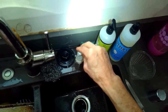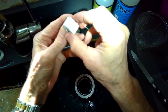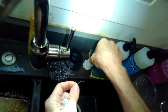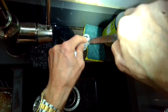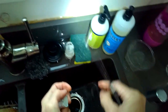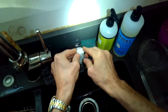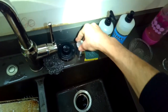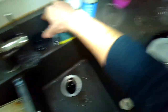There's also a way you can check if you're having trouble with your dishwasher not draining — often it's the air gap. You can pull off the two covers, and I noticed on this one there was a little fish bone caught in the center tube. That's pretty common, and it can create a matrix where other debris builds up to the point where it actually clogs the machine's ability to drain. Pull the silver cover off, then the white cover, get it cleaned up, then put the white cover back and the silver cover back with the opening facing the sink — and that did the trick for this dishwasher.